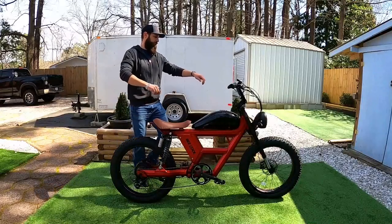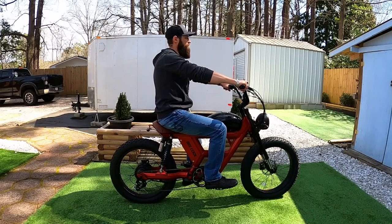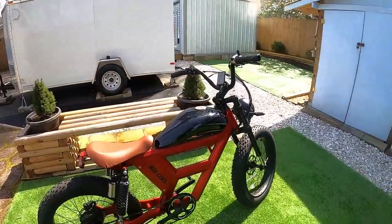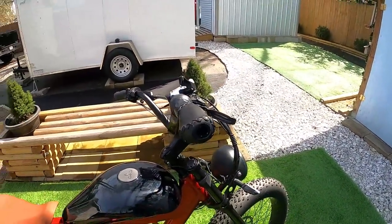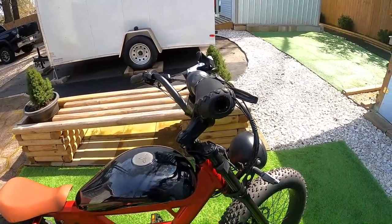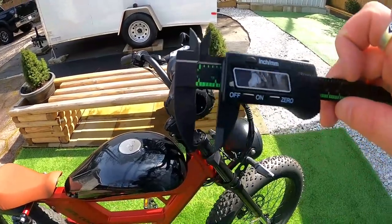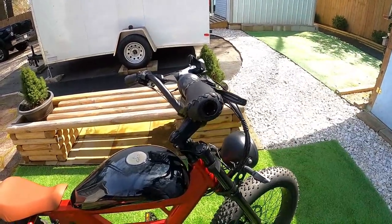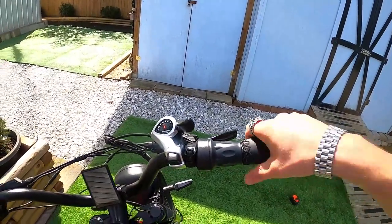It's a really comfortable seating position on this bike — it really feels like a cruiser motorcycle when you're riding it. Your hands are up high, the seat's low, it's a laid-back comfy cruiser setup. One thing to note: if you want to put bar-end mirrors on this bike, the bar opening is a non-standard width — it measures 13.1 millimeters — so keep that in mind when shopping for mirrors.